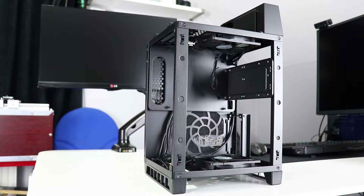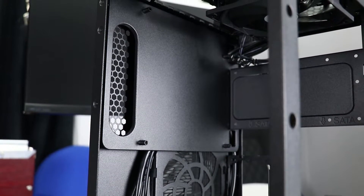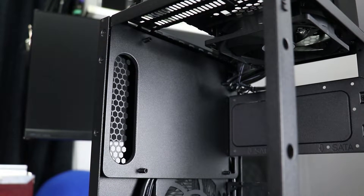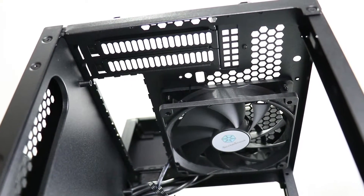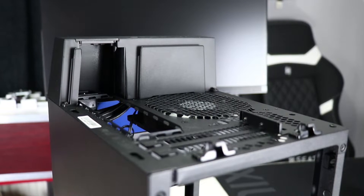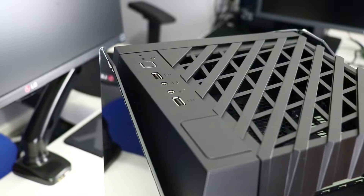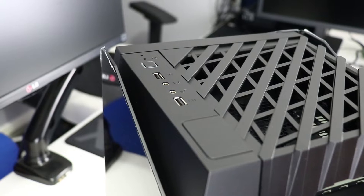We'll take a look at the parts bag in a minute, but we'll cover the insides first. The rear is the motherboard tray with fixed standoffs, which I like, but it does add the risk of losing a mount if you accidentally strip the thread, so be careful not to over-tighten your motherboard screws. Up top is the second 1200RPM 120mm fan in an exhaust configuration, assisting the natural convection current. Just next to it is a hole for the IO up top — not the top IO, but the rear one that also happens to be up top, about 10cm away.